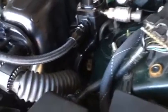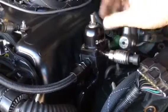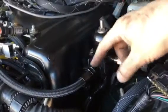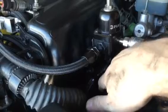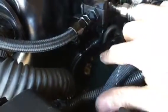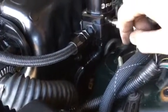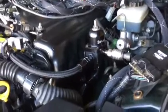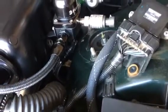I got the fuel return line hooked up. I ended up having to turn my fuel pressure regulator around so I could fit my fuel pressure sensor because it wouldn't fit the other way — this was originally flipped, and I had to turn it around and switch the sides on my fitting. It barely made it over the shock tower. I also had to use an angle fitting down here to clear that area — with a straight fitting it would have bent the hose. I could still get my finger under it, so it works. The line is slid under the panel and hidden now.